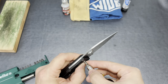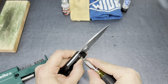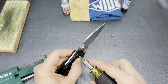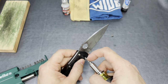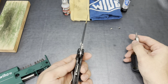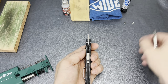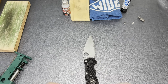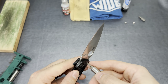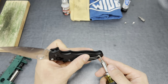I really need to invest in a mat or something here so that I can keep all my screws organized. This is using — I would imagine it's blue Loctite — but it is really packed in there. So we've got that pivot. I'm going to take both screws completely apart and try to keep them oriented with the handle, separated side to side. I would hope these body screws are T8s and not T6s — yeah, that's going to be a T8, and the rest of the body screws are T8s. So no T6s on here, which I'm happy to see.